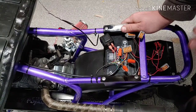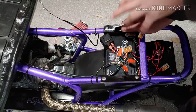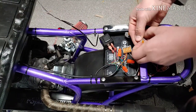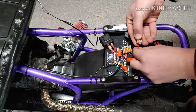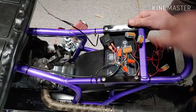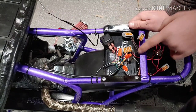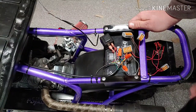I bought this tail light on Amazon — I bought all the lights on Amazon. I bought the flasher unit on Amazon; I can leave links in the description below. If you want to know what these terminal blocks are, they're just WAGOs. They have this cool little orange tab that you can pull up and then slide out and put your wires in — it's easy to remove. And then obviously I have my negative terminal block, and in there is the brown wire that takes all the negatives from the fixtures up front, then the negative goes down to my negative battery terminal.